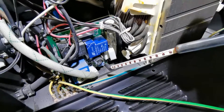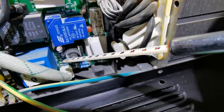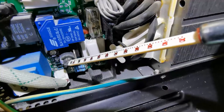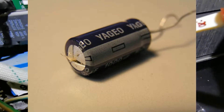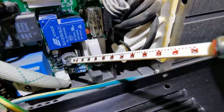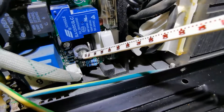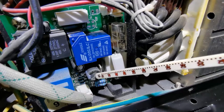The second thing you want to do is pretty basic — just eyeball the little circuit board. You've got a series of capacitors. See how the capacitors have been crimped in this formation? A blown capacitor will be flayed open with what looks like very thin fibre. I'll put a picture up now of what a blown capacitor looks like. If you can spot a blown capacitor on the board, you're going to have to remove the board, desolder the capacitor, and buy that component — they're very cheap. It'll be a really cheap fix; otherwise, a repair shop will swap the whole board and charge you an arm and a leg.